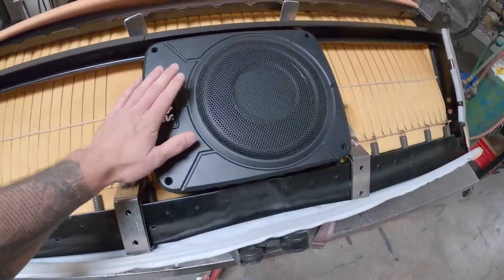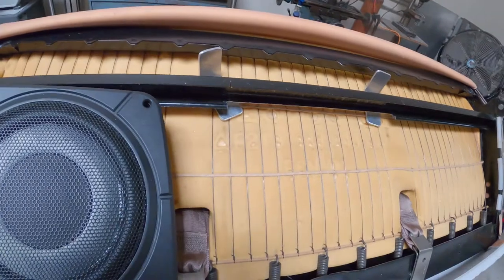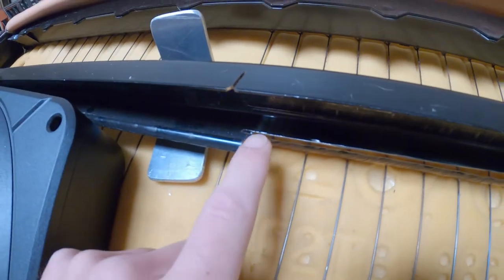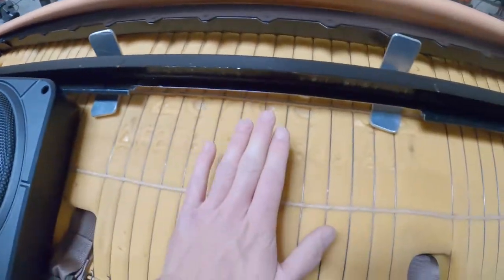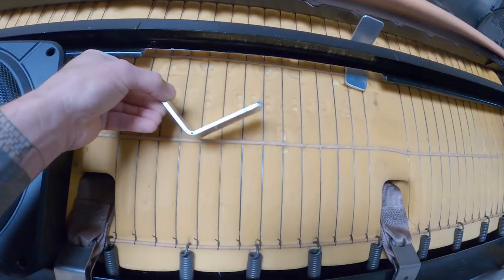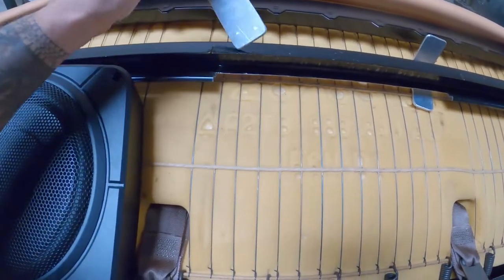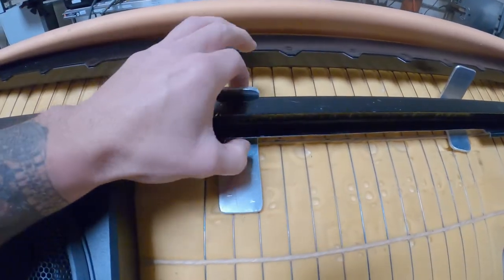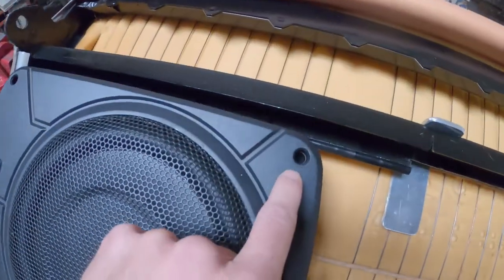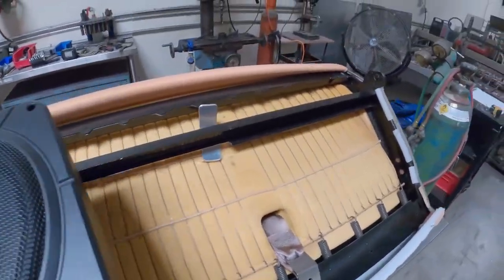For this particular sub, I'm making the dimensions work right here. What I had to do is come in and notch a little piece so the sub can sit more flat inside. I've also made some aluminum tabs here — they're not done yet — but the idea is I'm going to bolt it right here to the frame and then tap it to receive a screw right in there, so the sub should be nicely mounted.